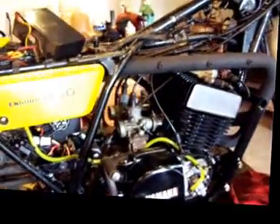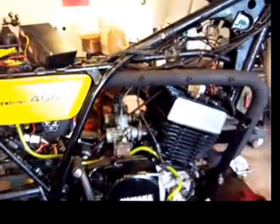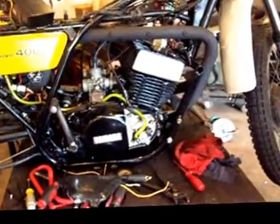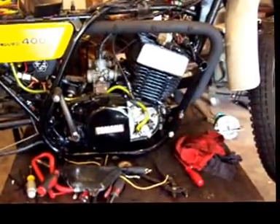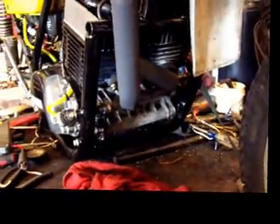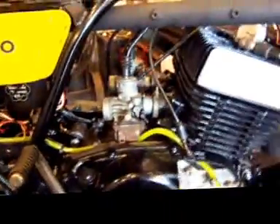Today we've got a 1975 DT400 — the motor let go in it a couple weeks ago. I bought an RD400, put that in, but it didn't fit so well, so I had to do some cutting in the frame and did a two-to-one exhaust with a custom pipe that goes under and still connects to the factory silencer. That gives us clearance for the carbs.